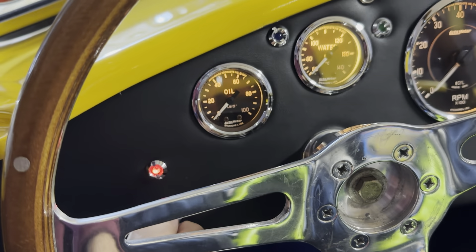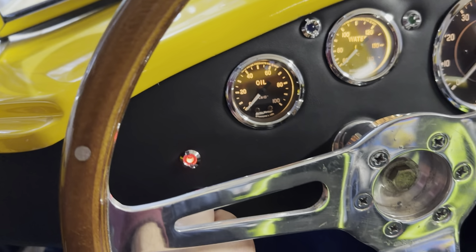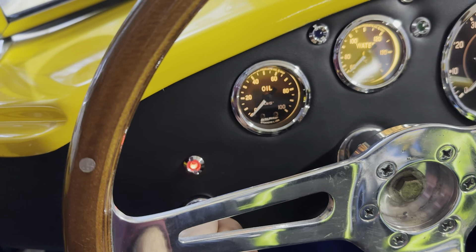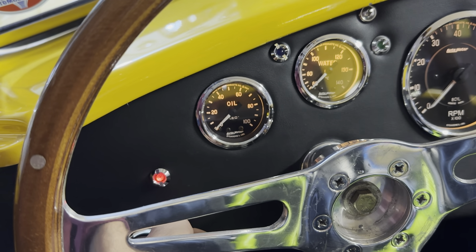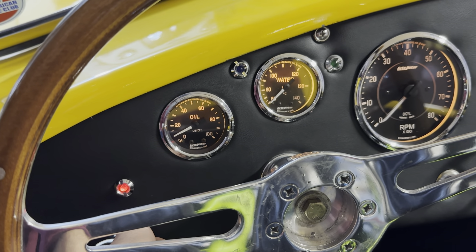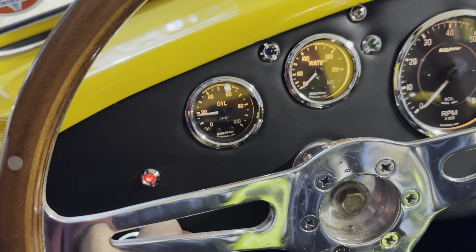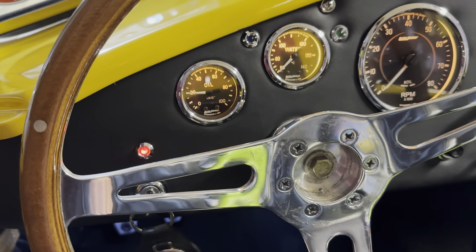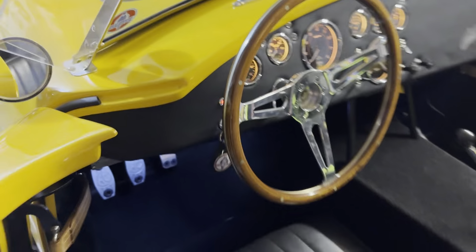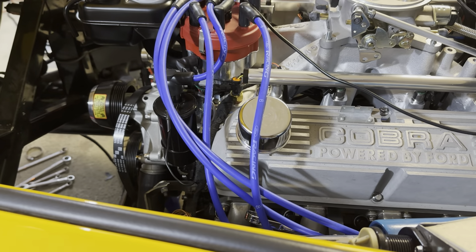I just went through a cranking cycle. Got it up to about 40 PSI. Checked both underneath here on the back of the gauge as well as the sending unit or the sender in the block — that adapter — and no signs of oil. You can see it will pressure up. Got a winner there. I think that is a job done as far as getting the gauge hooked up, all the lines plumbed, and no leaks. No signs of leaking down here or same thing under the dash. So yeah, we're going to check off the oil pressure gauge.